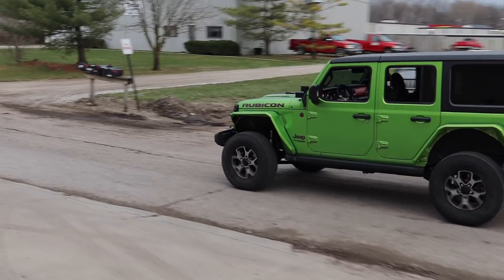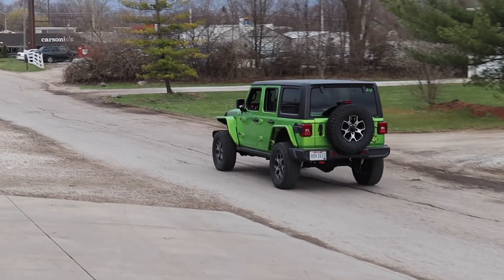He's making sure his steering wheel is straight going down the road. If it's not, we can adjust that. He's not going to get an alignment until his big tires are on. Every time you lift a vehicle it means you need an alignment, but Jeeps are a little different because you don't disconnect or drop the drag link — so you can just adjust it and fix your steering wheel straight for a little bit.